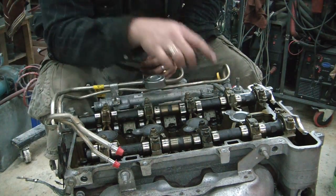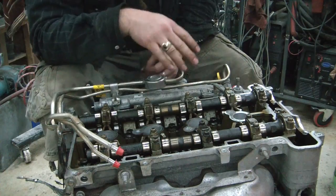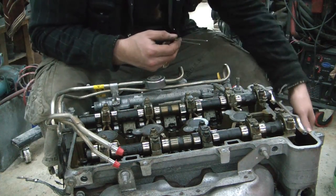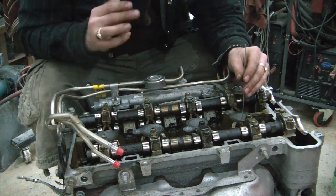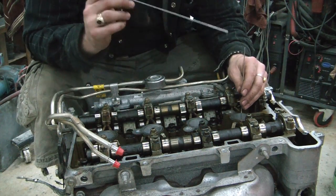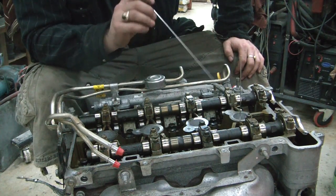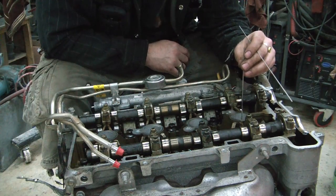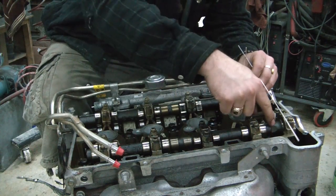Right now we don't have the gears on our timing chain connected to our camshafts, so when we turn the crank it's not turning the camshafts. Just one revolution around — four stroke — so we start at top dead center, then we have our power stroke going down, and when it comes back up again that'd be the exhaust stroke. But it doesn't matter right now because these valves are not moving, so as long as we know this piston is at top dead center regardless of compression or exhaust stroke, we can turn our cams right now.